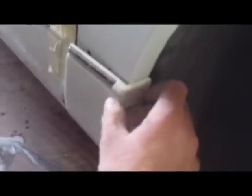And as you see down here, there's a piece of trim that goes along the bottom. Now I could have left it on and scuffed around it and put my tape on here, but I don't like doing that because I've seen people leave these on, just tape them off and then prep around it. The paint will peel and you'll see it lifting right there because it didn't get too good in that gap. So I decided, I popped it off, I dropped it, and I see that there's a line right here.